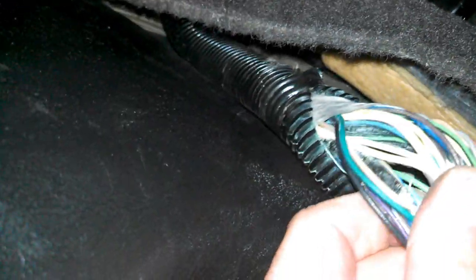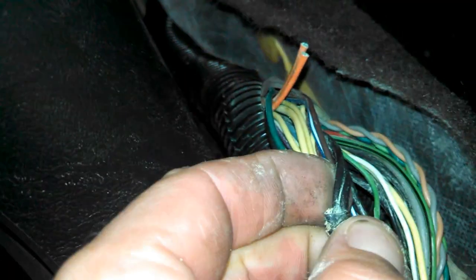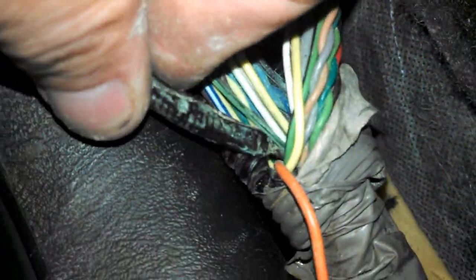What you're looking for is an orange wire, just like this, with some tape wrapped around it. And that's supposed to go to two orange wires, which are right here. So this wire is supposed to be connected to there. Normally it'll still look like it's connected, but if you pull on it a little, it'll break. And then as well as those, you have two black wires — you can see another bundle of tape here, and there's two black wires, and those go into a single black wire right there.